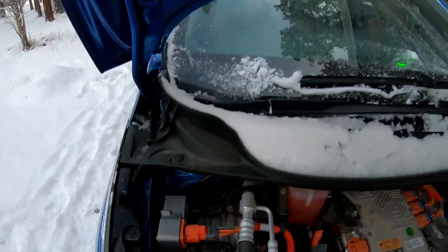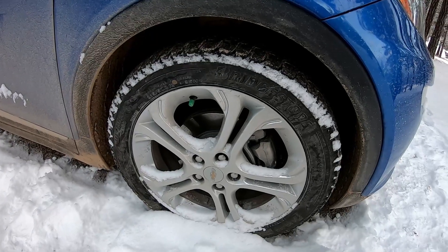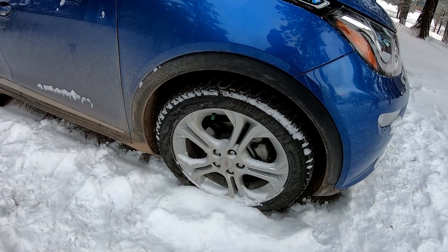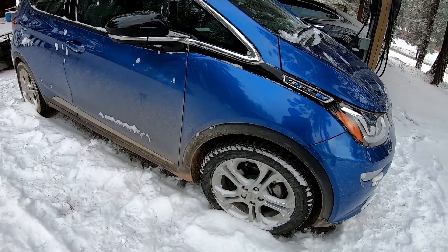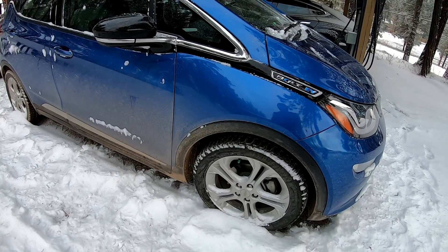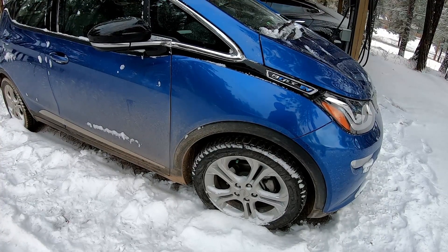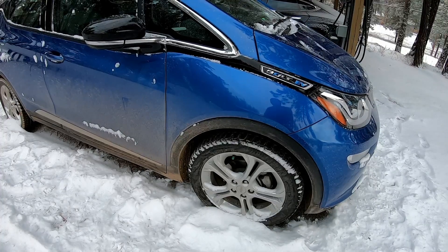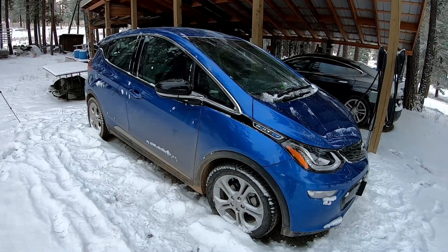You will need a lot of this because your windshield will get dirty driving in winter conditions. Last but not least, you need four good tires. You need highly rated studless snow tires for wintertime driving. Otherwise you do not have traction — not just to accelerate, but also to decelerate. Stepping on the brake with all-season tires or cheap snow tires, you will lose traction and this may end up in a disaster. Four highly rated quality snow tires are cheap insurance compared to having just a fender bender. Now the car looks ready, so let's go for a drive.